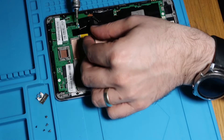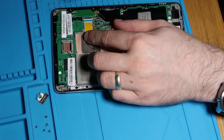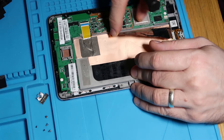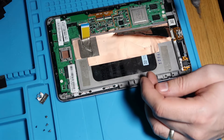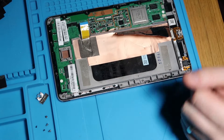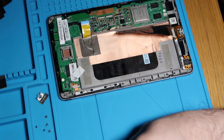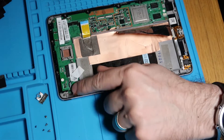The next thing we're going to do is get the other half of this cable all disconnected. We'll remove this tape and this heat shield, and we'll remove this tape to expose all our chips. Disconnect the cable to the LCD, disconnect the front cable going into the charge port, and then we will disconnect the digitizer cable. We'll also disconnect the power and volume buttons on the side. So that's all of our cables completely disconnected.